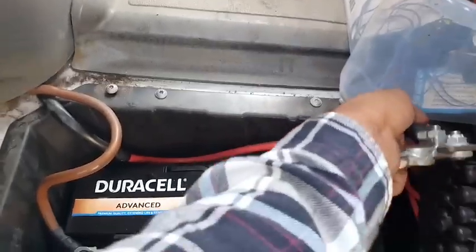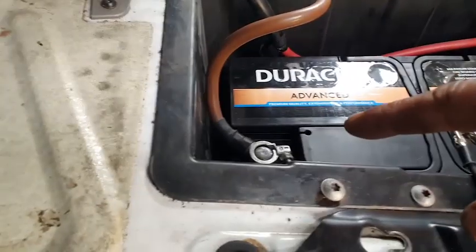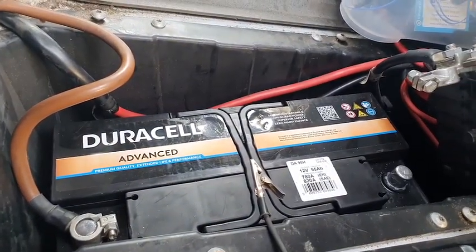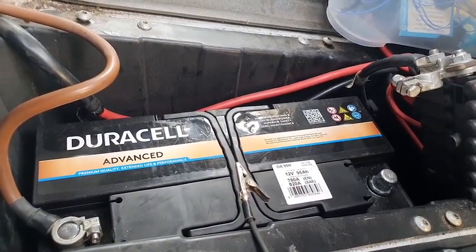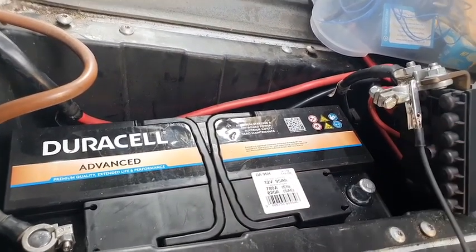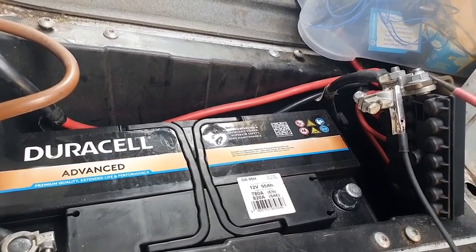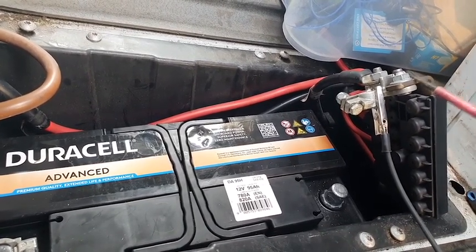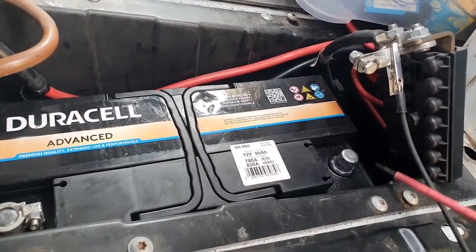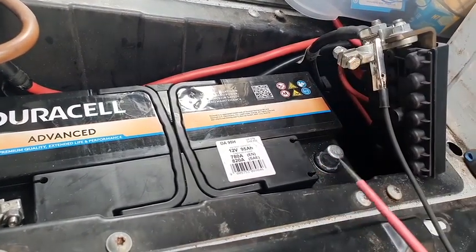Okay, there you go. Right, now that's my positive. I left the negative on the battery. That is my positive. It has a lot of wires going out. I'm going to connect the end of my test light on this connector, and I'm going to touch the battery positive. And if my light lights, that means we have a short to ground.